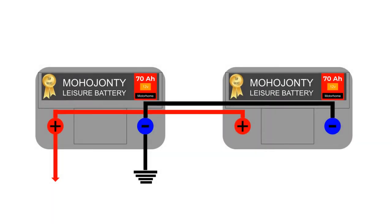The trouble with wires and cables is they soak up some of the voltage. The longer the cable, the more voltage they absorb. This is called voltage drop and is usually so small we can ignore it, but nevertheless it's there. In this case there's going to be a small voltage drop between the battery on the right and the one on the left — let's say about half a volt per cable, or a total of one volt. That means the left hand battery will always supply more power than the right hand one, because the right hand one is not pulling its weight volt wise. The left hand battery is working harder, and it's going to need replacing sooner — and when it does, you'll have to replace both batteries, even though one is still OK.